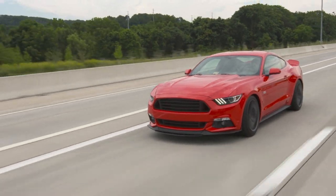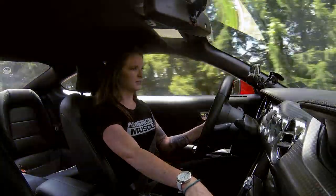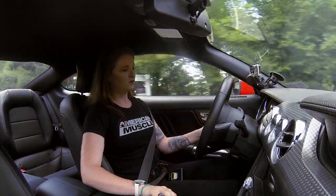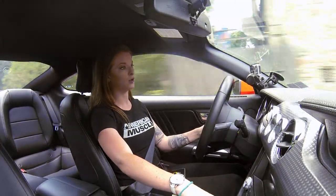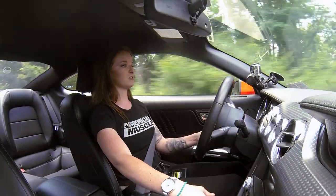I can feel already the car is with me a lot more. It's way more responsive steering-wise. It feels glued to the road. I'm not noticing any nose dive, and I feel like the car is hooking better. I haven't really done any hard launches, but I did squeal the tires a little bit — I got on it. The car spun the tires but there wasn't any aggressive wheel hop. There was actually no wheel hop at all. To me, that's a huge improvement over the factory.